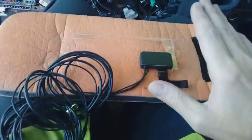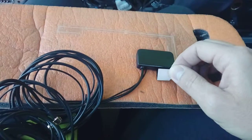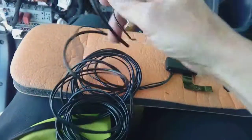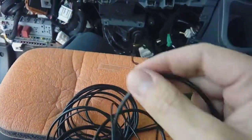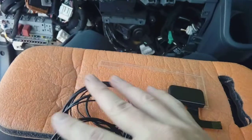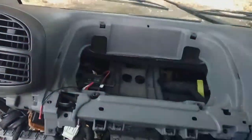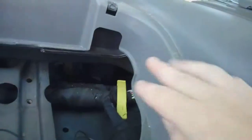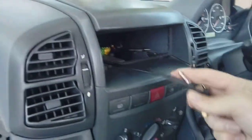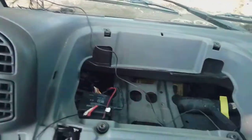Back inside the camper, this is our DAB aerial. It's sticky back — it's meant to stick on the windscreen and has a copper strip for earthing to the screen pillar to stop static. It's powered, so on the end of it it has a DAB connector and a black wire that we connect to the blue wire coming out the back of your new stereo — so that's the blue wire to power it. We're going to take the cable and run it so the connector comes out of here, across here, down, and up the screen pillar. Tuck your cables underneath, use a flexi bar to tape them and pull them through. I've got my mic cable here as well, and then we follow through all the way along.